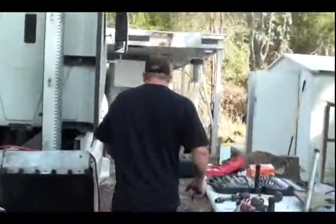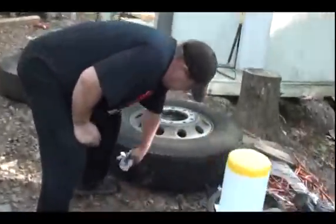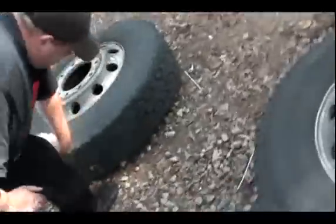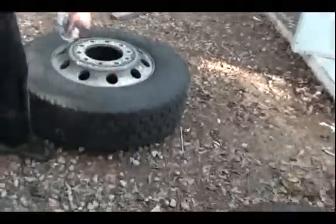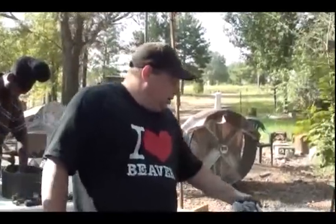These over here, the tires that came off of this one, I don't know if you want to come over here and look at these real quick. The tires that came off of that axle that only had 1 thousandth, they look beautiful. There's really no step wear in them yet. So you can see that 1, 2, 3, 4 thousandths of an inch is the difference between not being able to feel anything after 200,000 miles, or having a step.